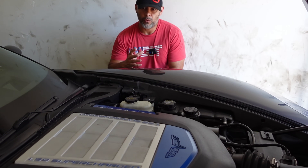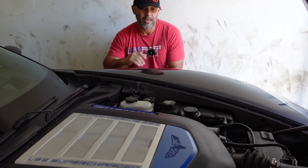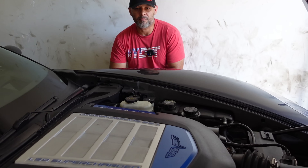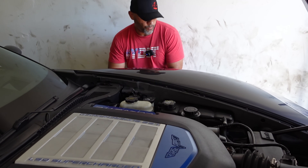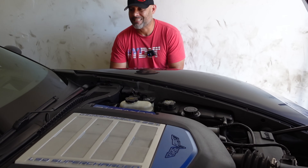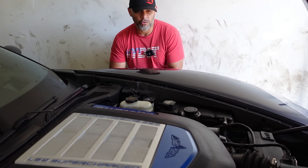He sent me a ported 2.3 liter supercharger. I'm not going to install a 2.6 on this vehicle. I think 2.3 liters ported is more than enough for what I need on this particular vehicle. 1,000 horsepower does not sound fun to me — 800 does. So that's the plan, to shoot for about high 700s, low 800s.